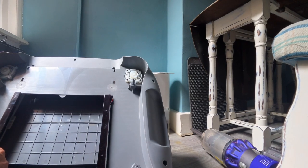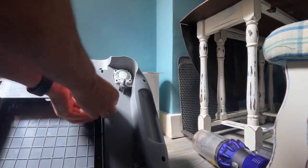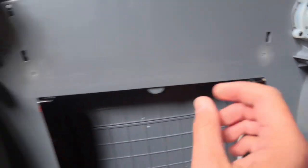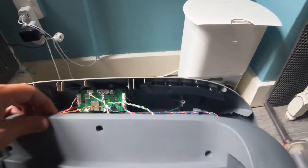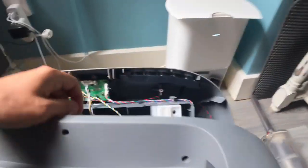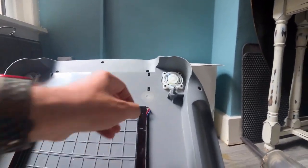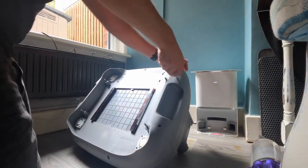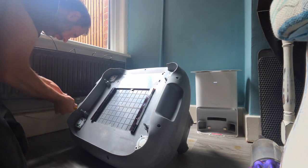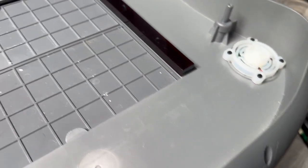You might want to poke some more of the cable up through there to tidy it up. Once it's all lined up just push gently — it's 3M tape so it should stick nice and easily. You can see now we've got the cables going up at the top there and at the top on the other side. This is all stuck on where it should be. Then remove the final protective tapes. Making sure we don't trap any cables, tuck the cable up there as we lift this into place — doing that with both hands. Now it's time to put all the screws back in — I like to go in an opposite pattern when doing screws.